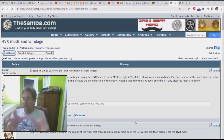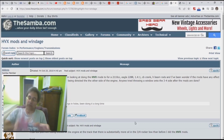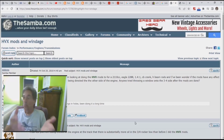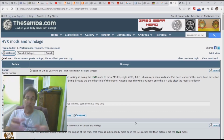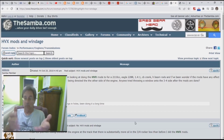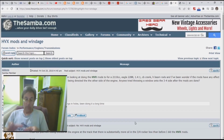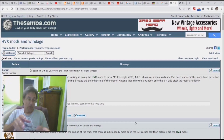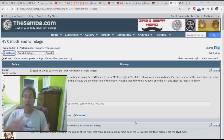So if I've got this massive pile of windage and it's causing inefficiencies in my motor, then I have to put more gas into my motor to overcome the inefficiencies. The extra gas is going to make my heads hotter. But you've Hoover modded, so now you're making your heads cooler. The net result is that you basically have the exact same head temperature for the same amount of power. Now, if you're like one of these airplane guys, so you've got a particular amount of power, you got a particular amount of cooling. If you got rid of the windage, you'd actually have more freed up horsepower at basically the same temperature. Well, at some point, I've got to end one of these videos, so let's do the summary.